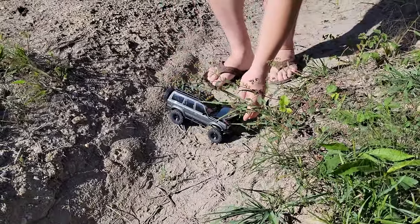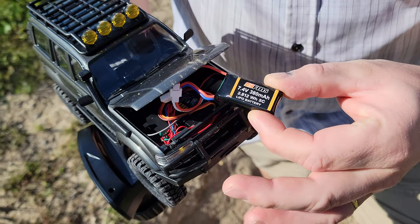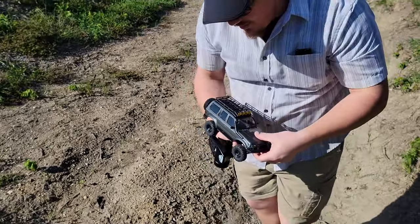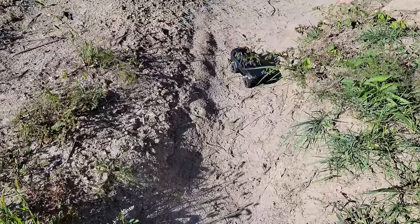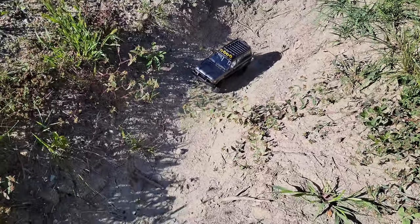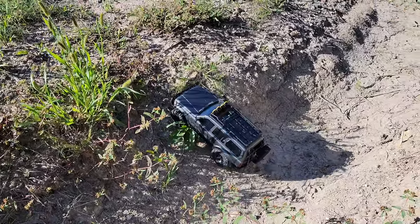We have the battery sticking out and everything — that's hilarious. Since it's popped out, let's show the people: 380 milliamp hour, 2S, just like what we've come to expect. Beautiful finish on this thing. Water resistant on this one. With these brushless motors, if you drive them underwater, they usually work for a little bit and then you have weird problems. So if you ever do have to replace a motor, we're thinking about doing a video to show replacing the motors — it's not super hard to do.